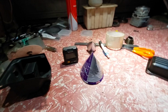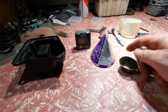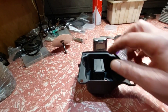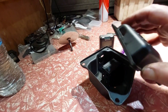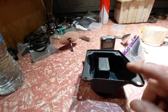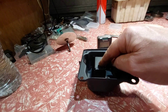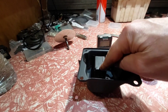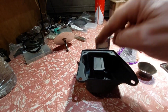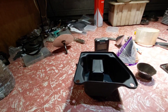I want to know what will work. The whole idea is mounting this part here perfectly where it has to be — long enough so it's a quarter-inch gap between this one and that one, just to let the exhaust gases out. I'll try and capture as much sound as I can in there. I'm trying to capture a little bit more fuel and air in the exhaust, like a tuned pipe on a motorbike. If I can throw more fuel and air back into the cylinder as the exhaust shuts up — say 10% — that 10% adds some more power. So I might drag this thing up from 13,500 revs to 14,000 or 15,000 revs.